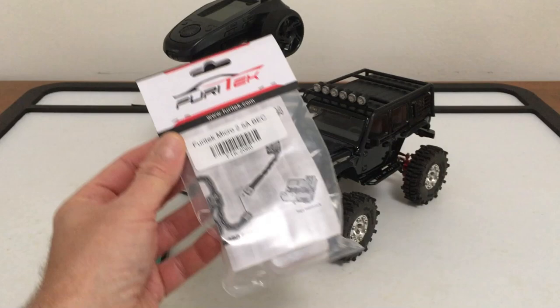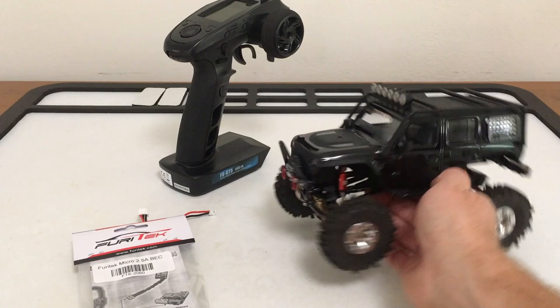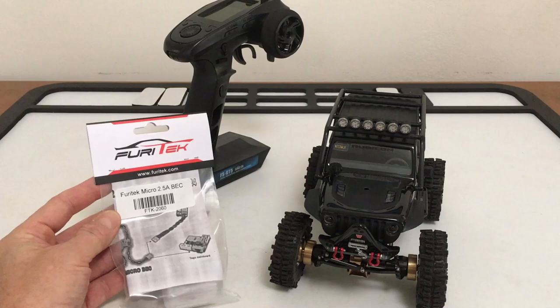With this guy being so heavy and having two servos and these big tires, a lot of width, so a lot of wheel scrub, I noticed running it that, even with an Emax servo in the front and a fake Emax servo in the back, it was having just some issues, binding up. So hopefully this BEC is going to give it a little more juice. Right now, this is a Lizard, so it's got a smaller BEC than the Tegu.